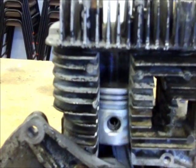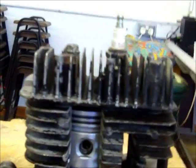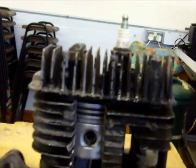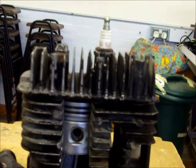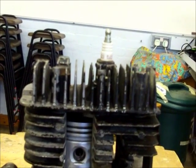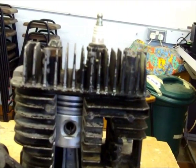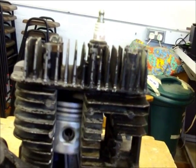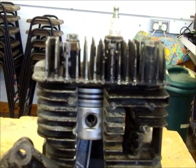You'll hear people talking about the size of an engine. They might say, my car is a 2 litre, or my bike is a 500cc. Now that's a measure of volume. cc stands for cubic centimetres, and the measurement comes from the sweep of the piston. So that's at top dead centre. So when it comes down to here, and it starts to return, that is the sweep of the piston from there to there. Now on this engine, I reckon that's probably around about 50 cc's.